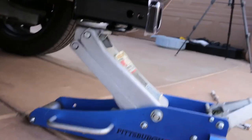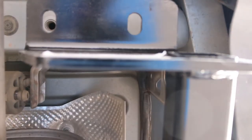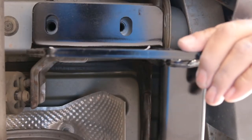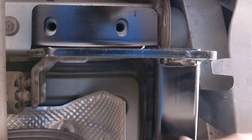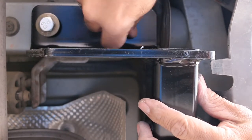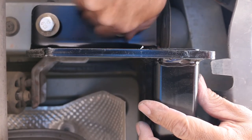Just a floor jack right there — that's my helper. What I'm going to do is jack up the hitch because I've got one side up. The other side is a little far off. If I didn't go too high, I ought to be able to hand tighten these. They leave oval slots here so there's plenty of room to make your alignment work.